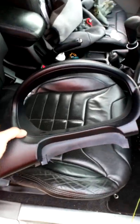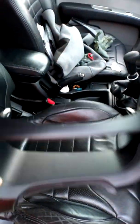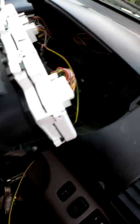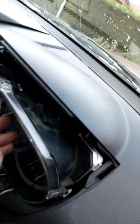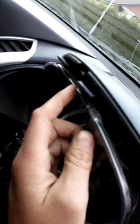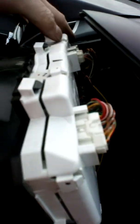Back at your clocks, you've got your trim — that just literally pulls off. You can see the locating clips, four of them, one at each corner. Pull that off and then you'll have to remove the clock. You'll have three screws: two at the bottom and one at the top. Remove your clocks and then it's your centre plug.